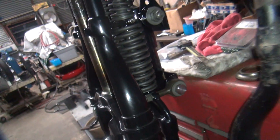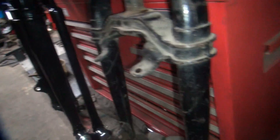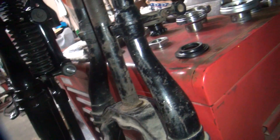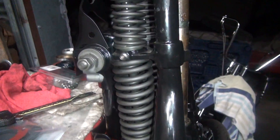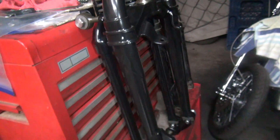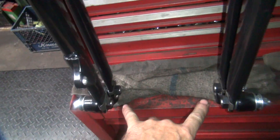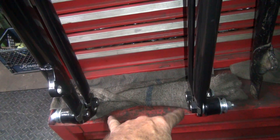Just like most all the stuff that's re-popped from V-Twin — it looks good, but it just doesn't cut it if you want good stuff. Right now this one here had the headlight mounted on already because it had all knocked up. We had to bend it to fit everything because it was all off. Just everything's off. Doing the width in here was close — I'm still about a sixteenth too narrow. I already bent this thing out about an eighth.